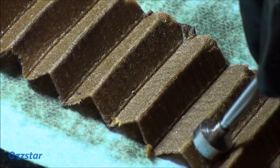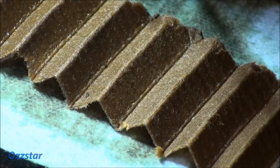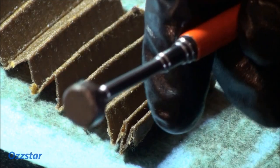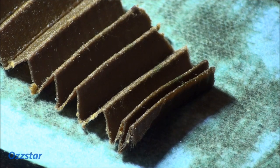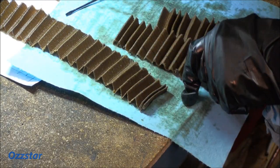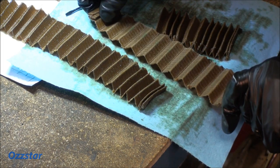I'm going to run my magnet across here — maybe it'll pick up a little bit of something. I just see a bunch of normal little filings. I don't think much of this came off when I was cutting the filter. The filings are so small. Nothing out of the ordinary, but there's definitely enough metal filings in here that I would say: yeah, change the oil at 500 miles. Be safe — it's not that expensive.